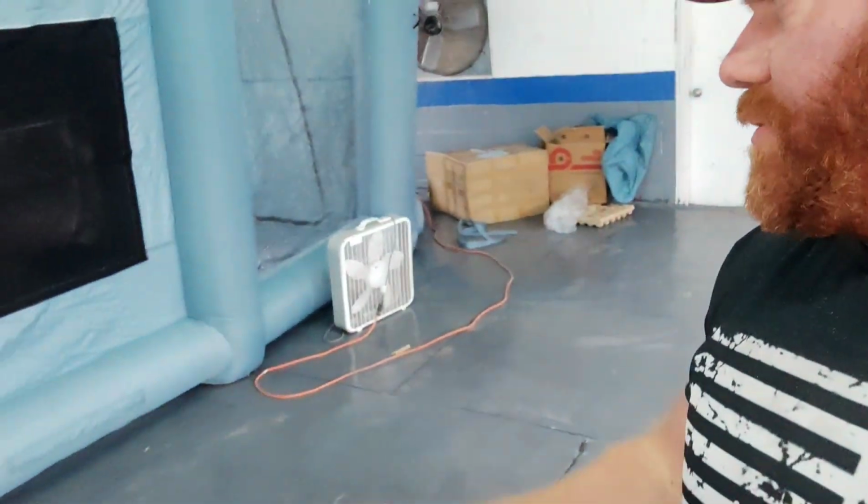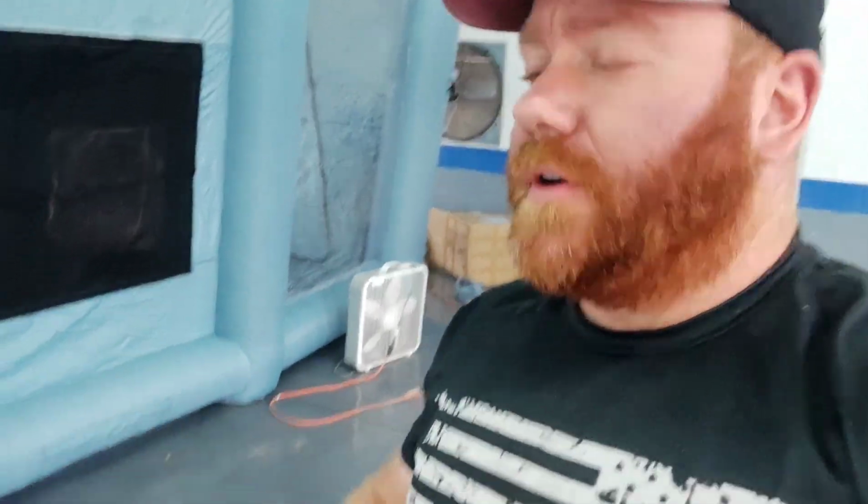Honestly, this little fan method, by the way, that's Sprayway Customs that came up with that. That's not me. He's the only one on YouTube that has done that trick of just sticking a fan in the filter. With the fan in the filter, it actually really helped out a lot. I wish he would have made that video sooner, like my other inflatable paint booth videos, because it eliminates having to buy that expensive $300 suction duct system, which barely helps. It's actually a way cheaper hack and probably creates more suction coming through the filters than the little suction duct snorkel system that they sell for these.